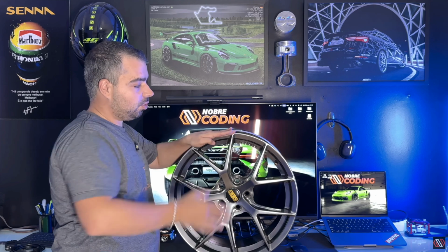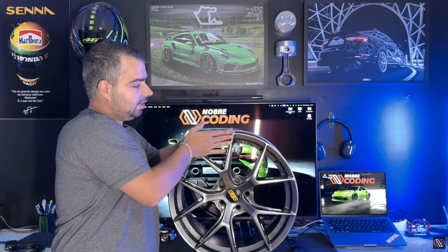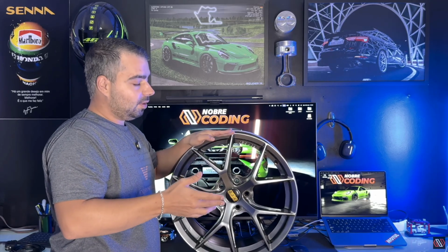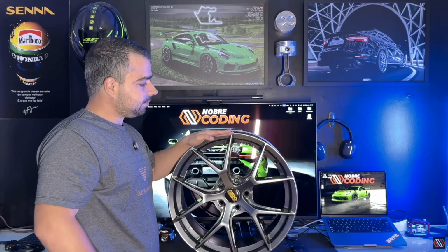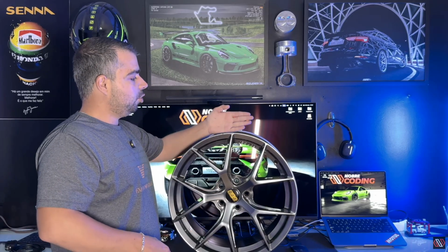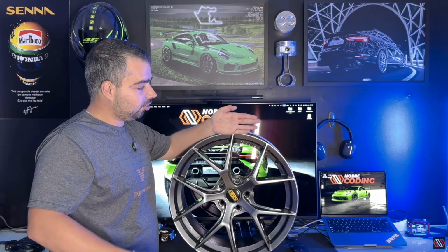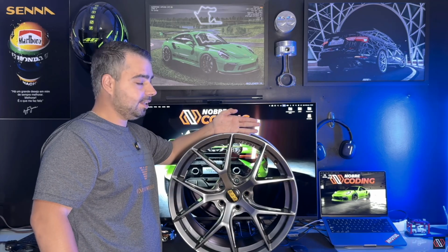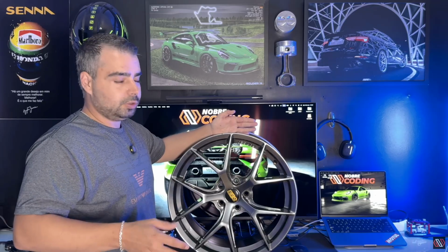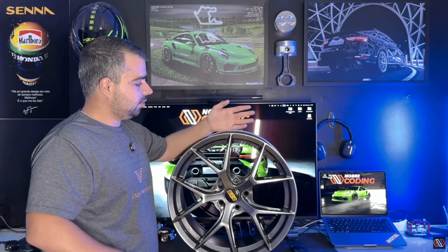And a lot of people don't like it. Why? Because the wheels are too inside the fender, it hides the wheel set, and if it is a little more outward it also helps a little bit there so that you can make more turns, okay? This one that is more outward offset, in addition to being a little more outward, the fender will be much closer to the rim of the wheel. Some people even mount it with the fender inside the wheel, right? But that's more for people who want to ride very low, who have air suspension, and then it makes sense, but for people who like to accelerate it doesn't make sense, okay?